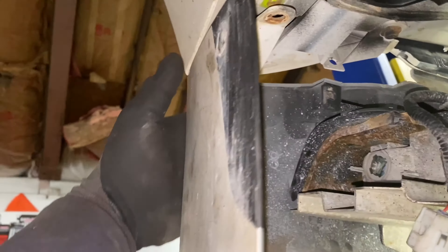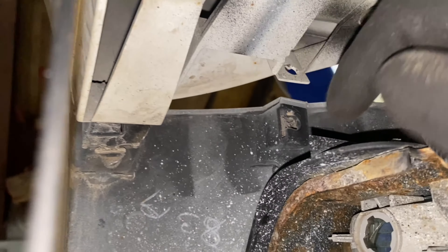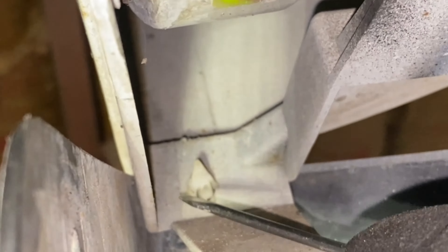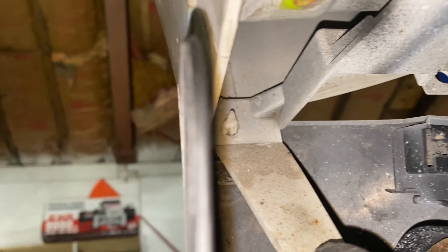I've got all the hardware out. I just wanted to show you guys these two rivets hiding behind here. To pop them out, all you need is some pliers or a flathead screwdriver — just push on the ears, push one on the outside in and this one inward, and once those ears go inward you can push it out. Once we get those out, this thing will come off completely.